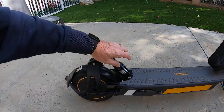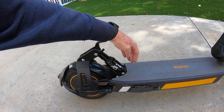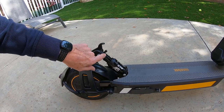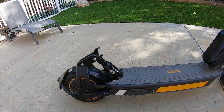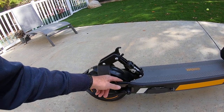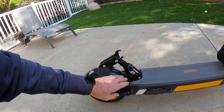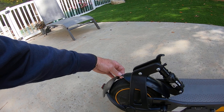For the rear I got the same shock absorber, inverted so it doesn't interfere with my foot on the board. The rear runs 100 PSI on the high-pressure side and 90 PSI on the low-pressure side. That's perfect for my weight — about 190 pounds. I also added a little rubber mud flap, just a piece of rubber held on with three rivets, to prevent mud and dust coming over that area — it works great.